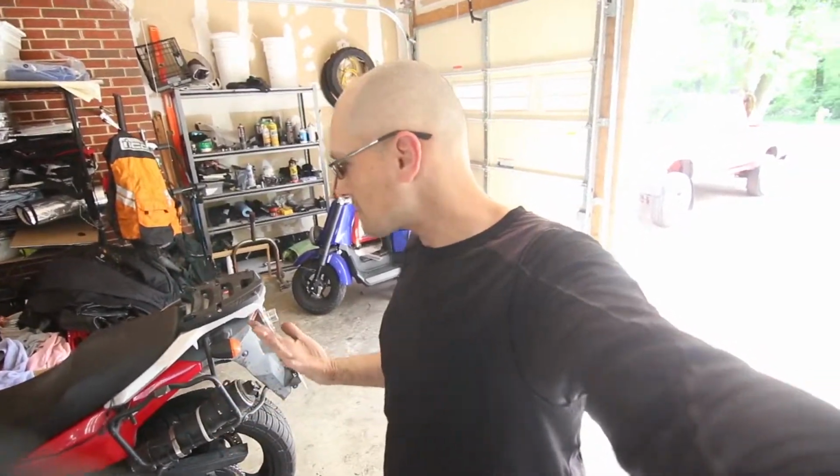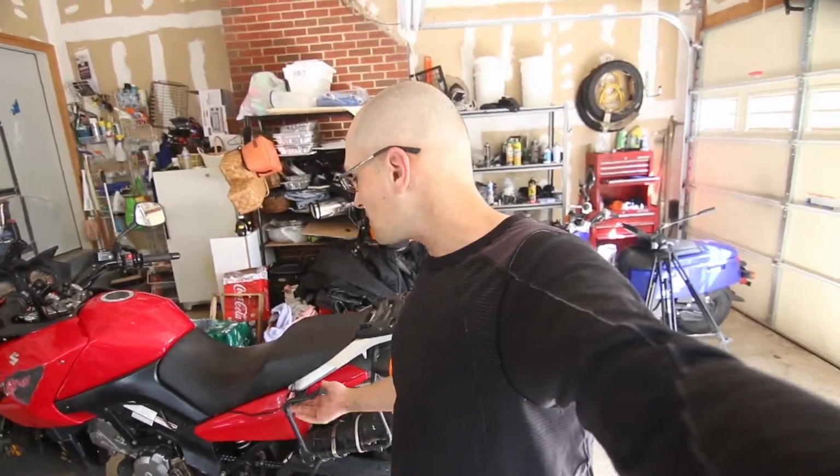It's just kind of messy, and I don't really like to get this messy, but you really just have to do this maybe every 20,000 miles or something like that. So it doesn't require that much. But once you do it, you're kind of like, oh man, I'd rather have a bike that's got a shaft drive, because then you just have to change the oil on the shaft drive. But on these, you have to remove all of this sort of stuff and add chains and sprockets once in a while. It's a good method of getting power to the ground, but if you want a maintenance-free bike or a low-maintenance bike, a shaft drive is one of the better ways to go about it.